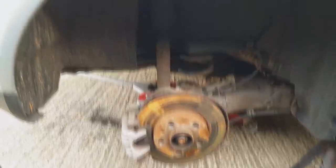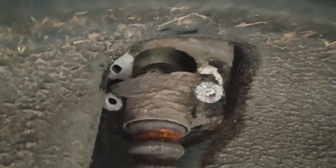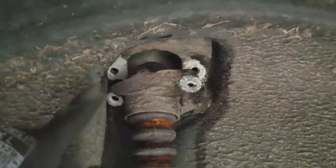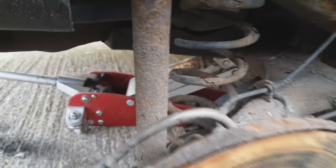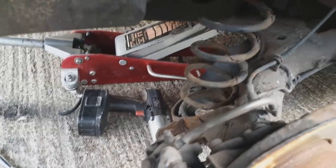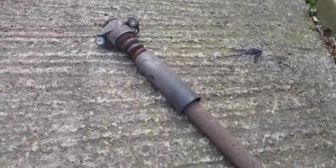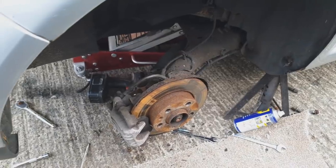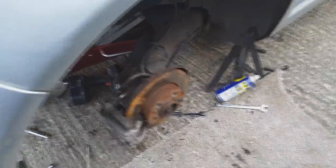The top two are undone — 16mm. The bottom bolt was also 16mm, so it's 16mm all round — nice and easy. This side of the suspension is now loose and she's out. That is a very soft damper. To get the spring out I literally bounced on the beam a bit and let it drop out.